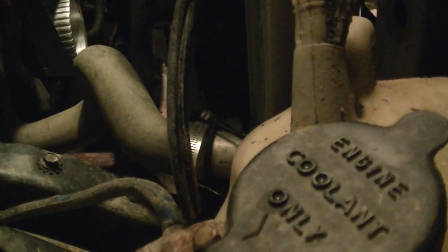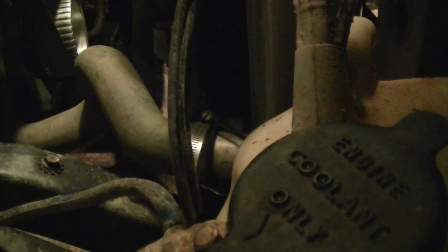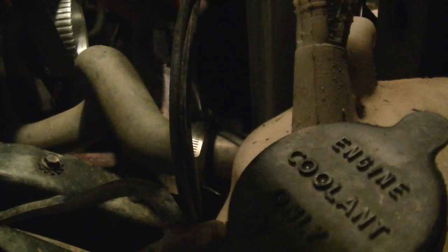Bear with me here because I'm, whoops, there's a hole there. You see that bottom radiator hose? Yeah, I got a pan underneath there to catch all this crap because I don't want to lay in it. So get you a flathead or a 5/16 or whatever your clamp takes, which in my case is neither. How is that possible? That's a 3/8. That's one heavy duty. Okay, already making me look like an idiot. So, flathead screwdriver, bottom radiator hose loose.